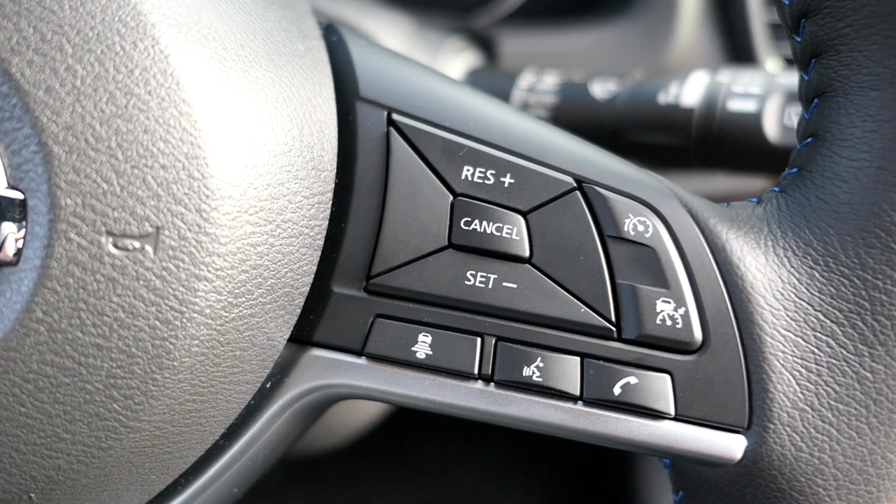Driving the Nissan Leaf 2 on long journeys is great. It's got radar cruise control, which works generally pretty well. Once you set it, you will keep that speed, and if the car in front of you slows down, it will slow down to match. Unfortunately, because I think it's got like a 45 degree cone radar beam, it actually picks up on cars in adjacent lanes. So if they slow down and the lane in front of you is open, it will just continue to slow down to match those cars that are next to you. That, you could say, is actually a good driving habit and you should always match the traffic speed around you. But conversely, on a multi-lane freeway setting, it just seems like overkill.